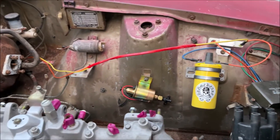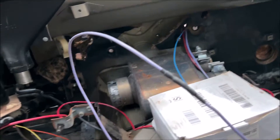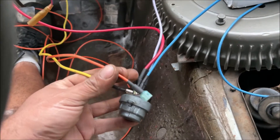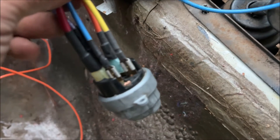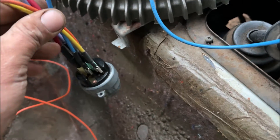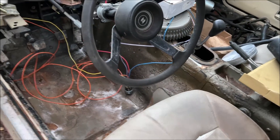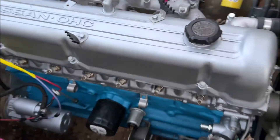I still haven't wrapped it up to the dash — we'll do that in the next video. We need to connect ignition orange and then R position to yellow. Notice how the covered terminals are staggered so nothing is touching, and we've used all five of our terminals on our ignition switch — nothing left. We only have five wires running into the dash and that's everything we need to run the car 100%. It's wired hanging out on purpose so you can see it.